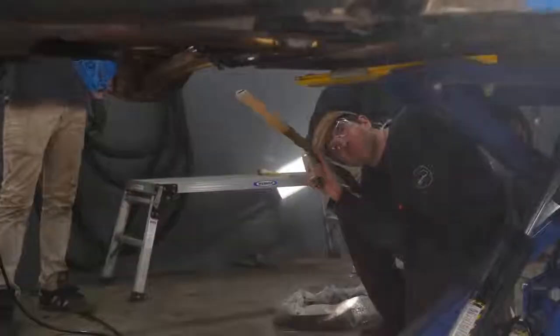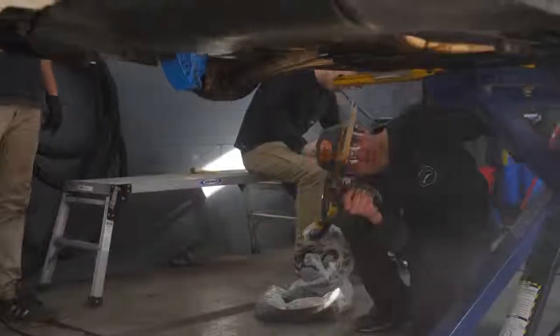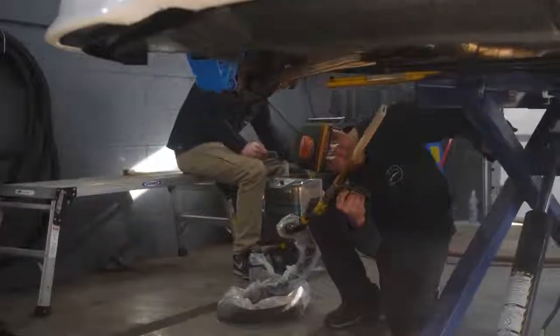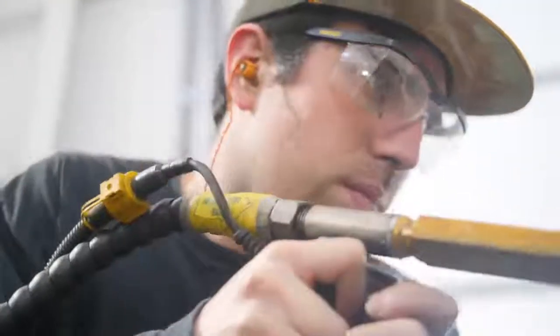I really like dry ice blasting because you have the ability to clean. On one side of the spectrum, we removed the ink off a business card with barely affecting the paper, and on the other side of the spectrum, people are using this to clean out cement mixers. It's totally adjustable. Being able to adjust the aggression of a cleaning method is really useful. So we're going in and cleaning the suspension components of Ben's Evo. We're going to try to rewind the years on it.